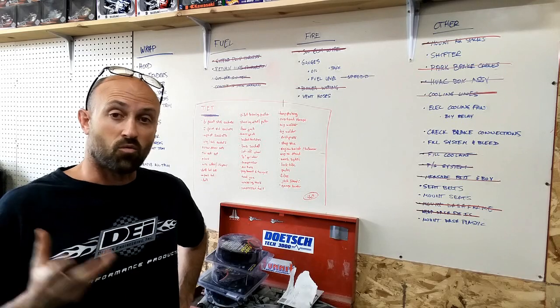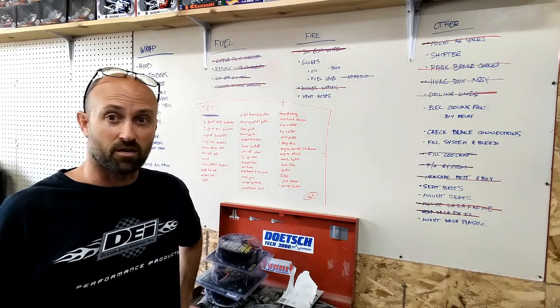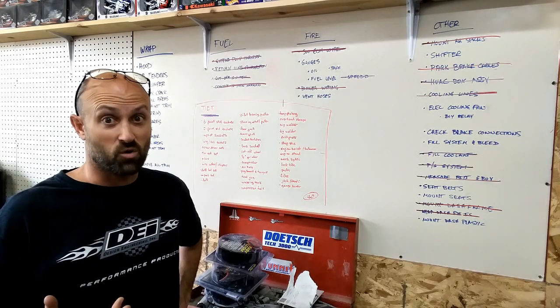I ran that, and sure enough, I then had the switched wire. Turned the key on, ECM clicked on, fuel pump clicked on, all the little bells and whistles lit up. So that was awesome. I now knew that I had everything I needed, and now I just needed to make it work. So once I got the ECM and all that clicked on, things went really quick after that.